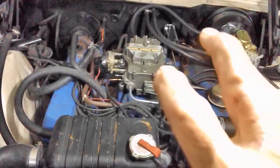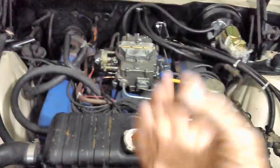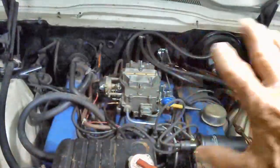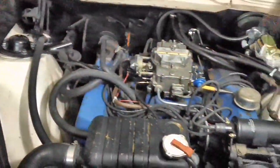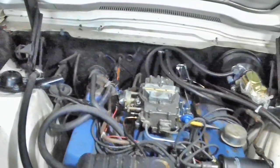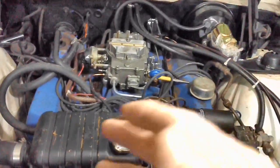Anyway, every engine has a certain amount of vacuum that it provides just because it's running. It's a sucking motion, sucking down, down, down. And the engineers took advantage of that to run hoses here, there, and everywhere. Some cars are just unbelievable. There's a million vacuum hoses. It's astonishing how many. They were able to run this item and this item and this item using the vacuum produced by the engine, the sucking of the engine. In our case, we have the brake booster with that big hose right there. We've got a bunch of hoses running over here to operate that thing down in there, to operate our door locks. No, that's an air conditioning reserve tank. The door lock tank goes up here, and other cars have all kinds of lines. So if that vacuum level is not right, then none of that stuff's going to work.